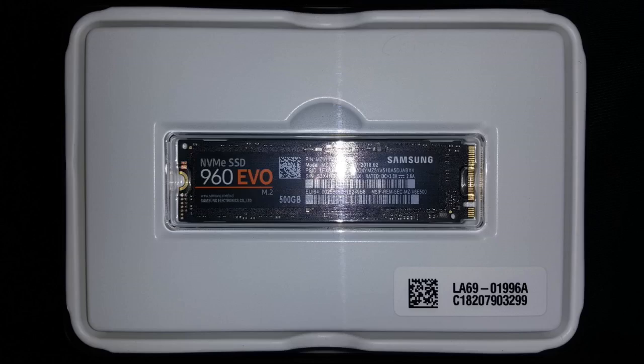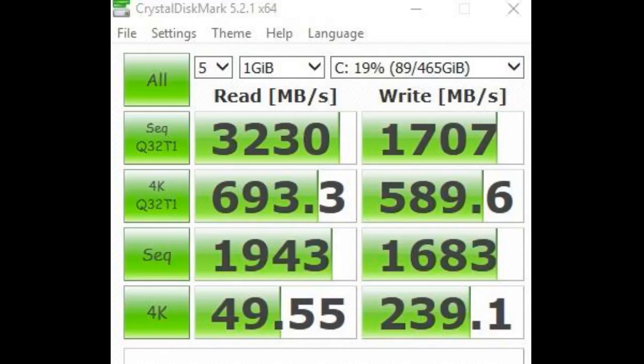Awesome. I was running my OS on a 256GB 840 EVO before this and it is definitely faster. I only had one issue after installing Windows 10 on it the first time. I left my 840 EVO plugged in when I installed the OS, so it didn't install a boot manager on this drive. The next day when I took the 840 out to put it in my laptop, my desktop wouldn't boot to 10 on the new 960 EVO drive.